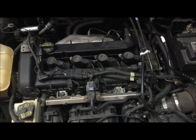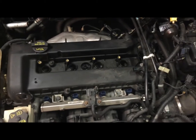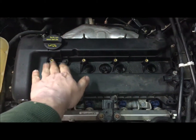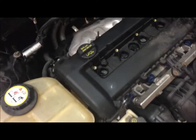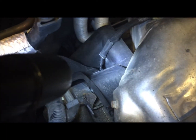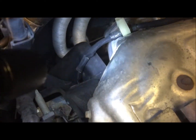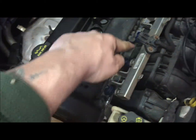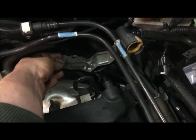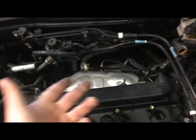All right, that wasn't too bad. I pulled all the coil packs out and disconnected all the wiring harness except for this alternator wire - you can see it runs up over the top and around the back. I couldn't get it to unplug from the alternator, so instead of messing with it I just unbolted this metal bracket that bolts on right here on this corner and set the whole wiring harness off to this side.